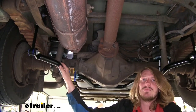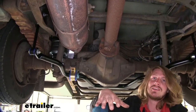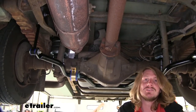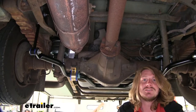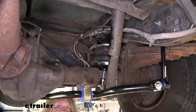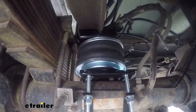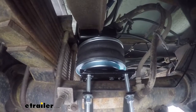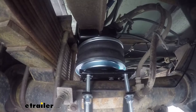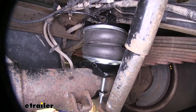Additionally, when you brake, most of the braking force is done with the front of your vehicle and the weight transfers onto that. If you're not level and even, the weight may not transfer properly. By making it level, it transfers the way it should, and that increased contact of your tire to the road is going to reduce your stopping distance. On larger RVs like this, they can also help minimize sway. So you're going to have a safer, more comfortable ride when taking your RV on vacation. You and your passengers will appreciate the better ride quality and safe trip. It's an easy, no-drill installation — let's show you how to do that now.